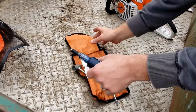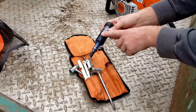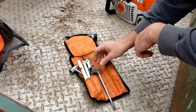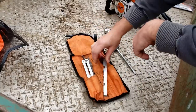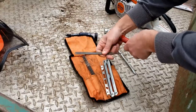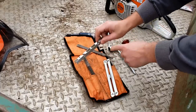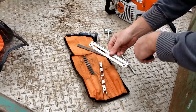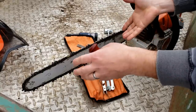This is the kit that I normally just take around with me. I think it's a County Line - I got it at TSC or Family Farm and Home. This little kit - this grease gun wasn't included, I got it separately, it's a grease gun for the bar on my Husqvarna chainsaw, my STIHL doesn't need it. The kit comes with a guide, a file guide, several different sized files depending on what size chain you have, and a multi-purpose handle. There's a file for the rakers or depth gauges, and then a guide that goes along the bar to give you the angle and depth to run your file through.